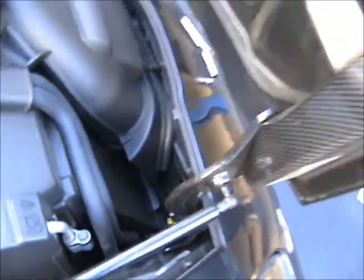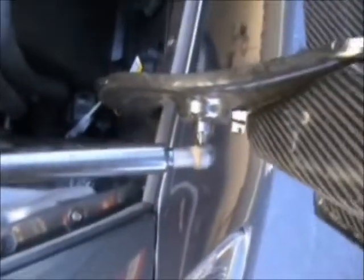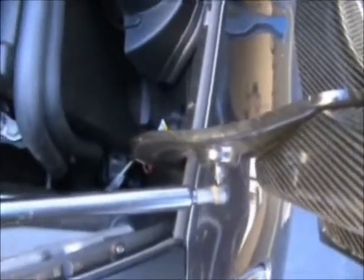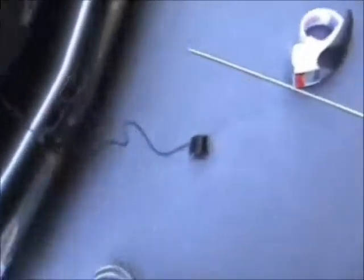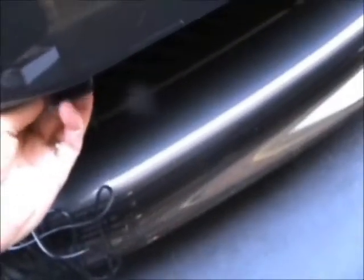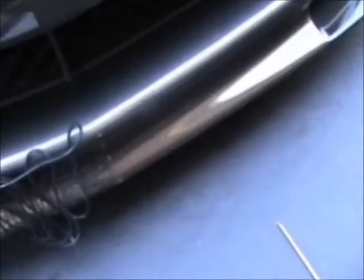You'll see it come through in just a second — there it is. We've pushed it through right here. I'm going to untape it. Now the sensor is through the grill and intake shroud. As you can see we've got the sensor wire now through the intake shroud. The sensor is laying here on the ground and will eventually go tucked up nice and neat and hidden. Now we're going to go ahead and start routing it to the control module.